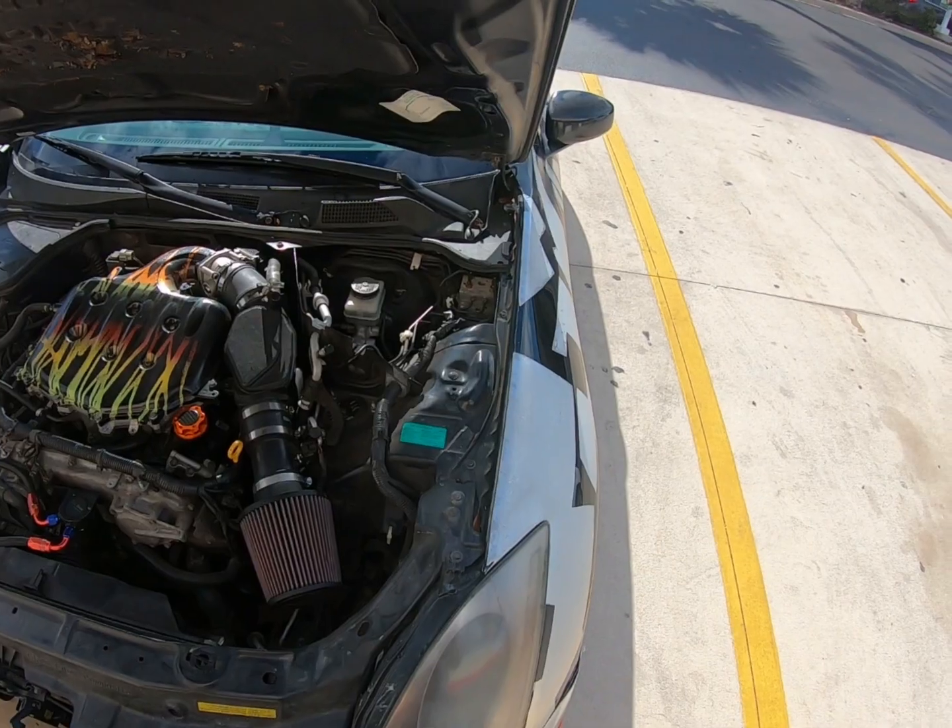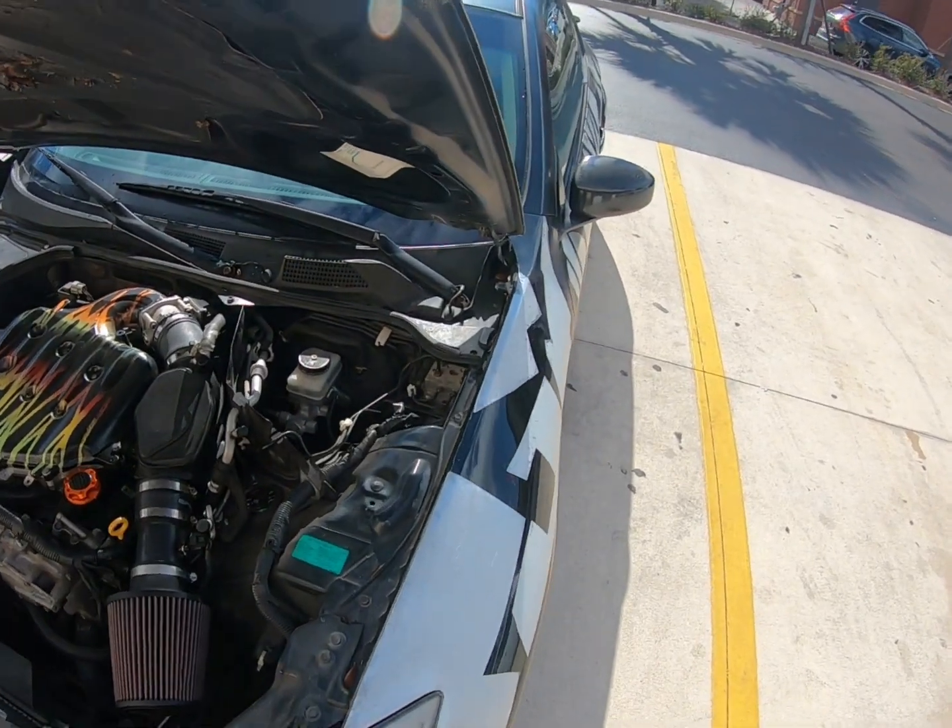Before I change that sensor, I have to change my differential fluid. The last time I put regular fluid — 80-90 regular fluid — this was the standard for the car, but you can use full synthetic 75-90 with LS formula. So we're gonna go to the store and see if I can find the formula I'm looking for. If not, I'll go to the shop and use the fluid I have there. Stay with me guys, and don't forget to like, share, and subscribe.